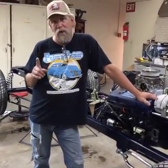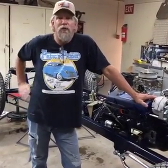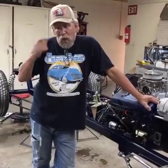This is another one. I'm going to put a star by this. LEDs are coming on real strong. When they first came out, your flasher is a capacitor that charges and then discharges and charges and discharges. That's what makes your lights flash. Well, an LED does not draw enough current to discharge that flasher.